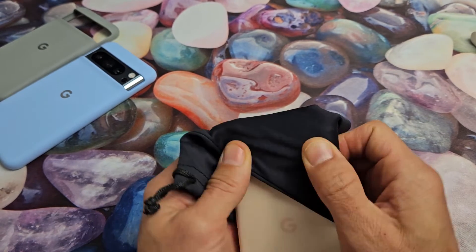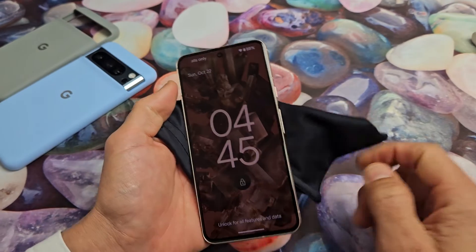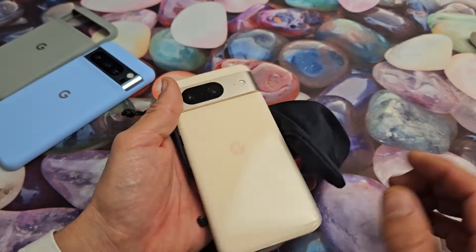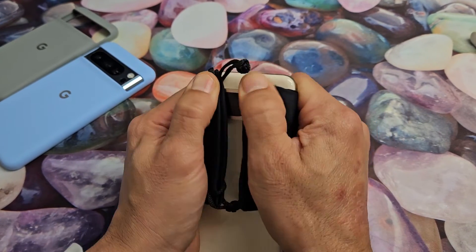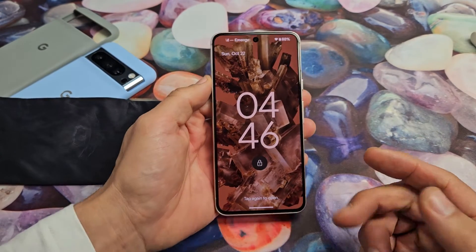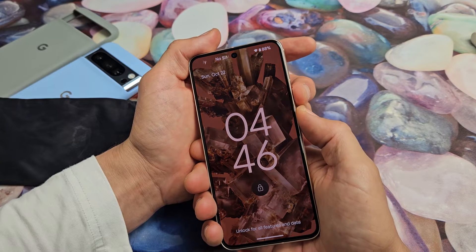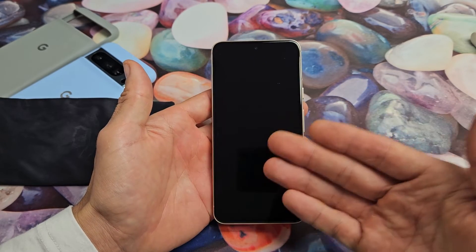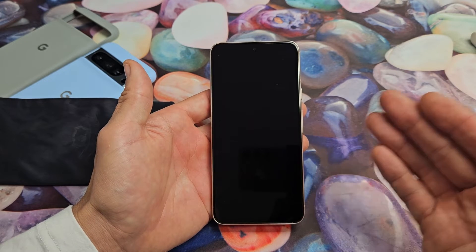If you hear a little click around there, turn that phone over quickly and tap on that power button and see if your screen is on. If not, or if you get half the screen or white lines, no problem — continue with the pressing or massaging on the back of the phone for a little bit longer, then turn it over, tap that power button, and see if your screen is on. If the screen is not fully on, same thing again — power button, volume up, press and hold both buttons at the same time, count to 20 seconds, let go, and wait for it to boot back up. You should see a Google logo, and then once the phone boots up, hopefully you're out of the black screen. If you still have a black screen, don't worry — we're going to go to the next step.